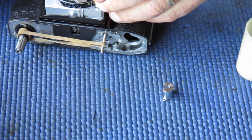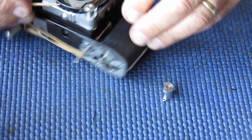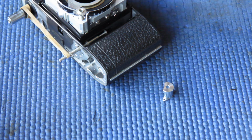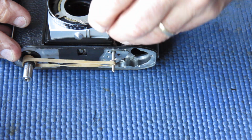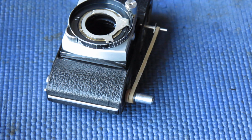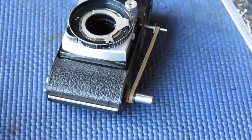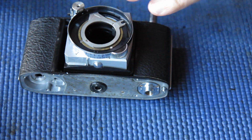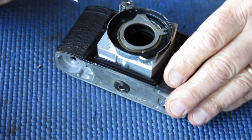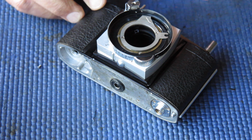This has to pick up that transfer shaft from the back of the camera. I can feel it pick up there. I'll put a smear on this front surface where this runs in this guide bush, this cover. Drop that cover into place. We have two screws, chromed brass, fairly easily marked, fairly easily damaged. The one at the top is easy to get to and easy to see. You need the pretty one there. The one at the bottom is more difficult to get to.